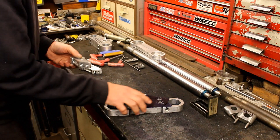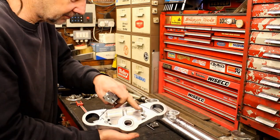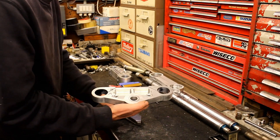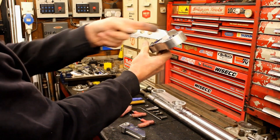Jeff drilled the fat yokes for the risers - there they are with holes in. These were originally off the other front end. He's had to keep the centers at maximum to make sure the bolt holes don't clash with the clamp holes. He's come in a little bit, and will swap in some stainless bolts. The risers will sit at 43 degrees on the yoke, pulled back almost flat.